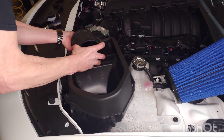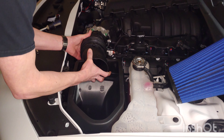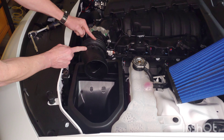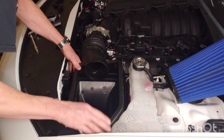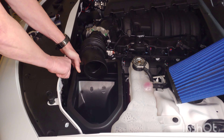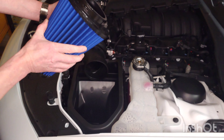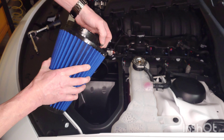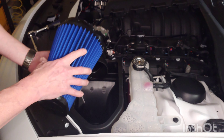We're going to line up our air inlet tube with our air filter housing — and that went on pretty easy. I noticed this is clocked a certain way; there's a piece of rubber on the air intake tube that coincides with this notch. Look down into the bottom and make sure you're lining everything up there. You'll also notice on this band clamp we have a couple of raised sections — that's just to keep your band clamp from rotating around while you're installing and tightening.